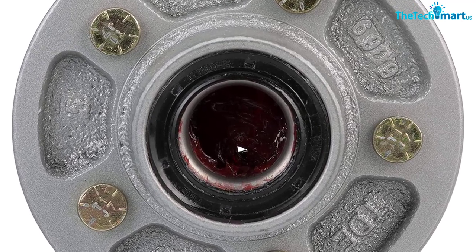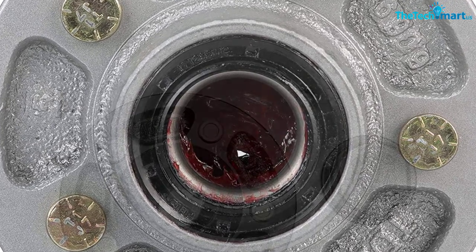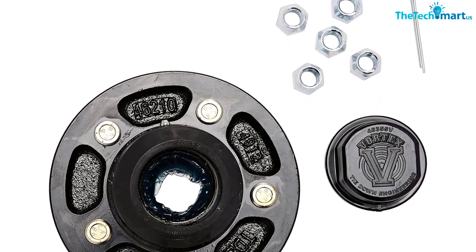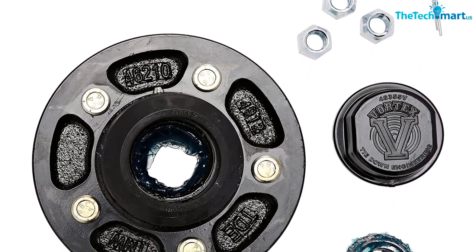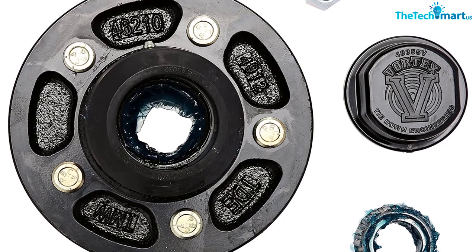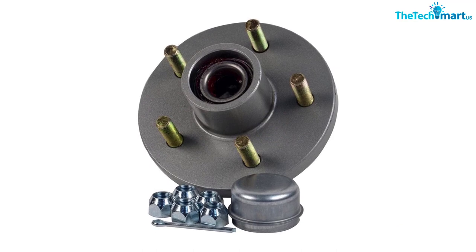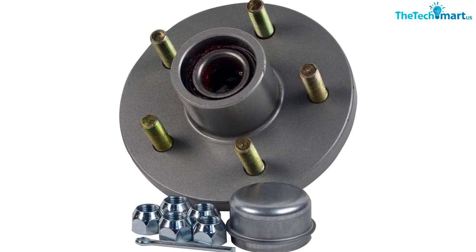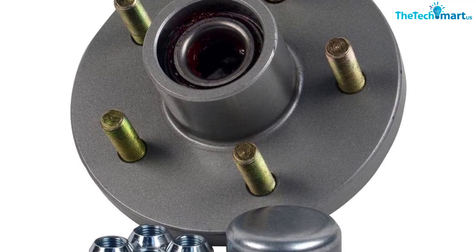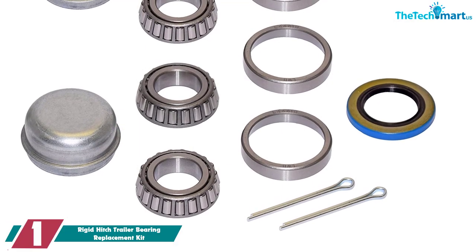The bearings are already well saturated with Kendall high-temperature marine grease. A cotter pin and dust cap are included, and it's set to fit a 1-3/8 tapered to 1-1/16 shaft. One thing worth noting is that there's no grease fitting on the back of the hub, so you'll want to ensure you have something to keep it clear — bearing buddies are always a good idea. The included cap is closed with no grease zerk and no easy way to apply more grease, so it's best to swap it for something else. Overall, this may not be the top-of-the-line model in durability, but you cannot beat the convenience and ease of use.